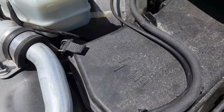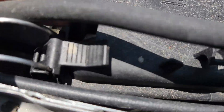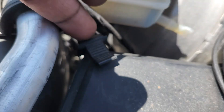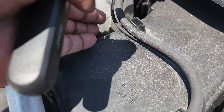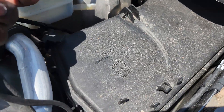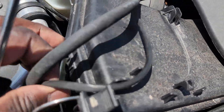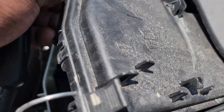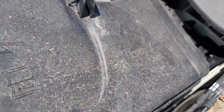To access our fuse box, we open the hood. It is going to be next to the driver, immediately after the strut. You're going to unclip these two clips and then remove them. There will also be some clips on top. You take them out and then pull it to the front, because on the rear they just hook in, so nothing is going to be holding it back.